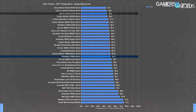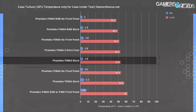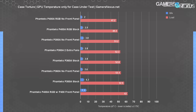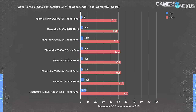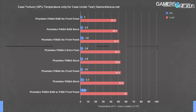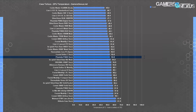The strongest competitor from a price-performance perspective is the Lian Li Lancool 215 at $80, averaging 45°C in this test. Average GPU temperature in the combined torture test was 53°C above ambient for the P360A; removing the front panel had no effect, remaining at about 53°C. The top of the PSU shroud is sealed with no bottom intake vent, making airflow in the lower half a closed system. The P360A far outperformed the P300A's 58°C average. With additional aftermarket fans, the original P300A was planted at about the same performance as the P360A stock result.